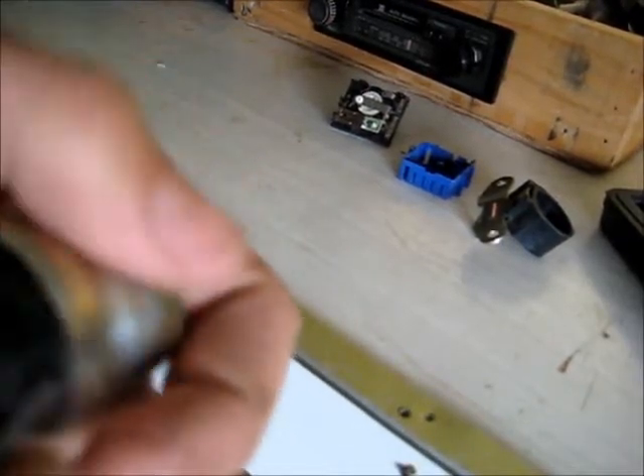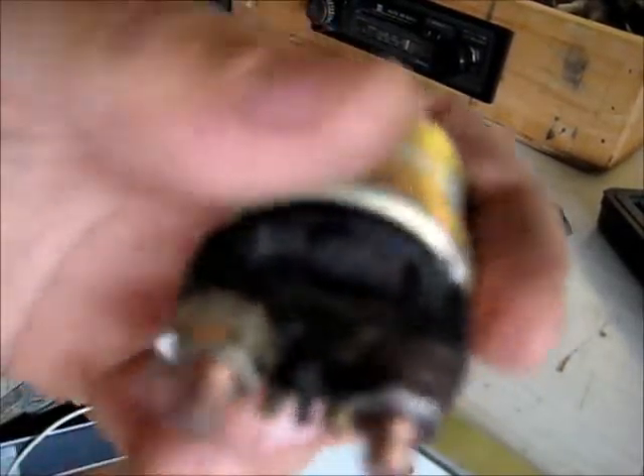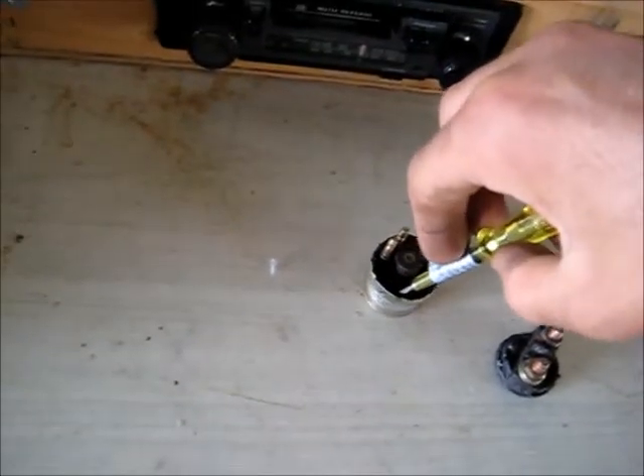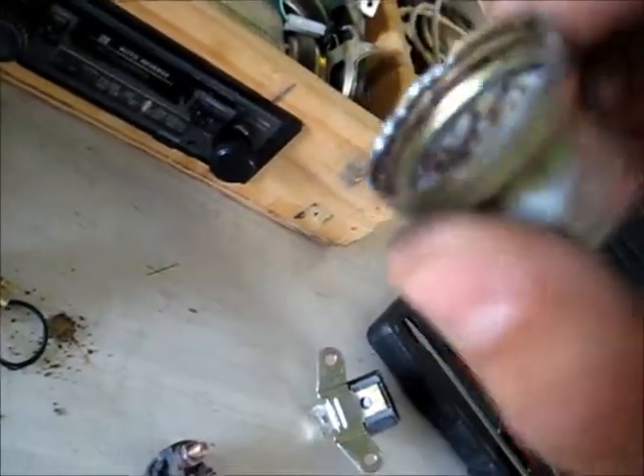So this starter solenoid here - I'm trying to pry it over, just scooting around it, just keep making my way around it, just prying it open. This might take some time. I'll just do this and try and get this opened up and show you why this stopped working. I've got this relay apart - basically what I was doing: just got an old flat screwdriver, pushed it right into the edge, hammered it, twisted and worked my way around with a hammer, just twisting it, unfolding it as I was going. Now I was able to unfold it enough so I could tap the side and wedge it off equally on both sides. Look at this dirty old thing.